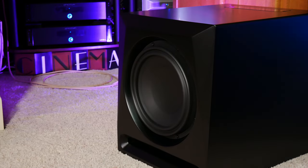The RS11 really gets to take advantage of its engineering and build quality here — it reproduced this part of the soundtrack while maintaining complete detail and control of its output. It did such a good job we decided to keep turning it up until it just had so much bass we couldn't take it anymore and it began to overpower our main speakers. Despite this, the sub never actually distorted and we weren't worried about overdriving it thanks to its transparent limiter, which according to Emotiva makes it virtually impossible to overload the RS11 or make it sound bad. Throughout our testing, we experimented with the port plug in and out for both movies and music. With the plug in, it tightened the sound up a little but also reduced output. We prefer sealed subs, but we found that we like the sound of the RS11 in most cases with the port plug out.